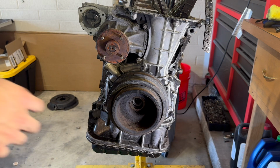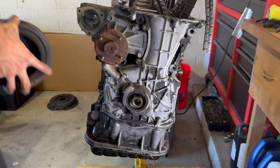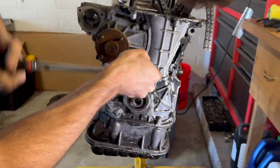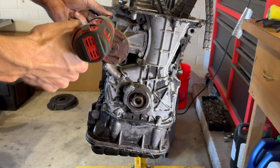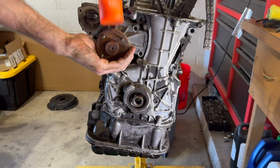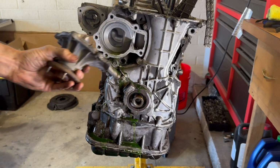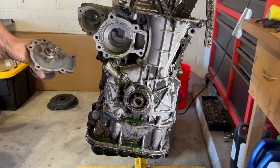You'll see right here in this clip that the oil pans are back on. Now, on the chronological order of actually how to remove these components, the video is correct. When I was actually doing it, it would have been incorrect because the oil pans have to get taken off first before you can take the front timing cover off.